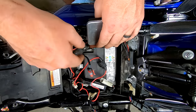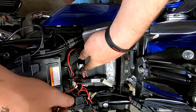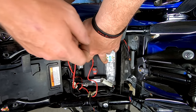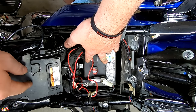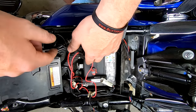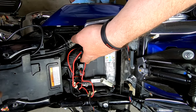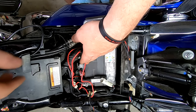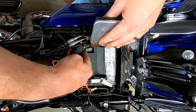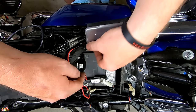This is a mess — I had to get to the battery, and that's the problem with having too many Custom Dynamics products. The next step is to remove the seat to get to the battery. I also remove the gas tank, and I'd highly recommend doing that. It's so simple on these bikes — it took me five minutes, it's four screws and a quick disconnect. The reason is it makes for a much cleaner wire run under the tank and gives you way more access. Then disconnect the negative terminal.